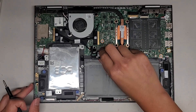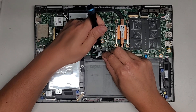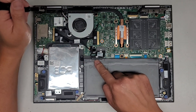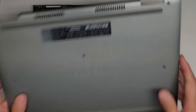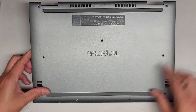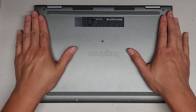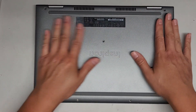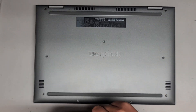One other thing — the battery connector is here, but it can be very difficult to remove, so I have to use a tool to get in where it's raised to push it back. You also have to remove this part of the connector to transfer it to the new one. It helps to put the bottom cover in at an angle because of the little clips. Get that in and clip everything up, then get all the screws back in.